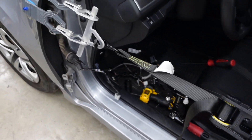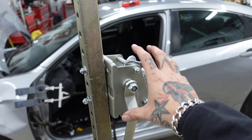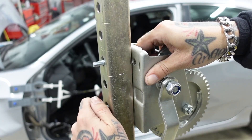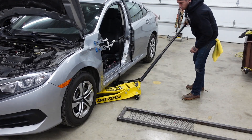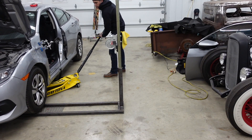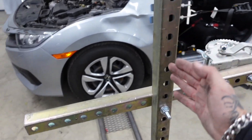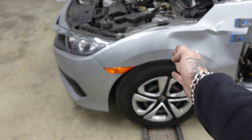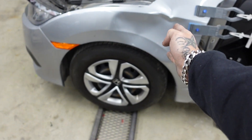I'm all strapped up. Now I'm going to throw my glue pulling ram underneath the car. I'm going to adjust my winch down to the lower setting so I get a more direct pull with the fender. This glue pulling ram can be mounted anywhere on the vehicle — the front, the back, underneath the tire, or the pinch welds. With my winch dead center, I wasn't making a direct pull on the fender, so I went ahead and put an extension plate on and pulled my winch out to the side to get a direct pull right into the damage.